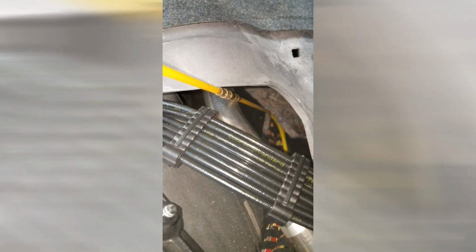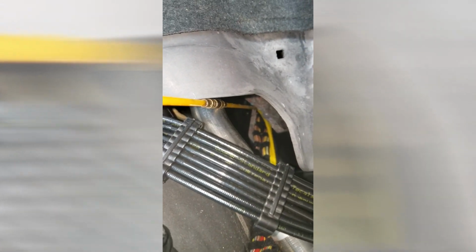So to get the black power wire to go into the trunk, I ran a fiberglass rod from the trunk into this compartment here so that I could tape the power wire onto that, and then I just pulled it back through. So that is actually coming in through this side back here. Took a couple of tries to get it through there. It's going in there, but following existing cables and in between some, it looks like, fiberglass insulation.